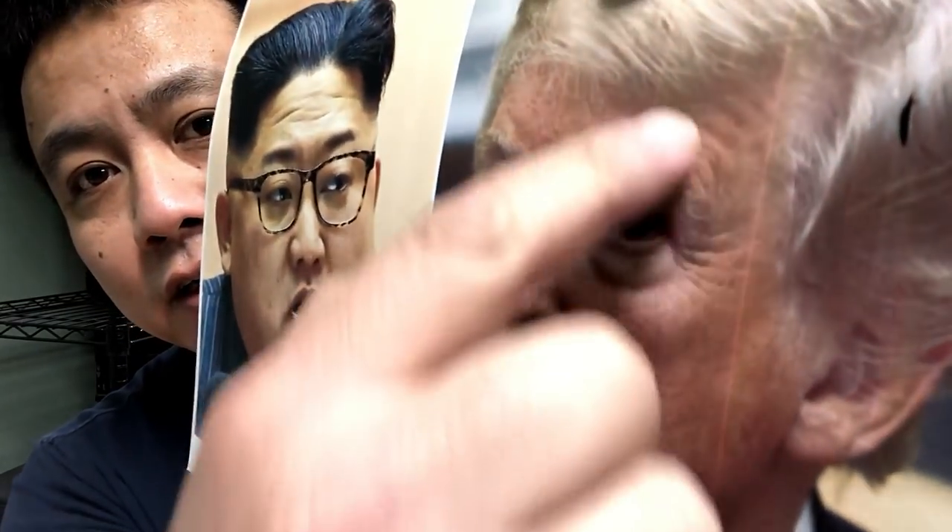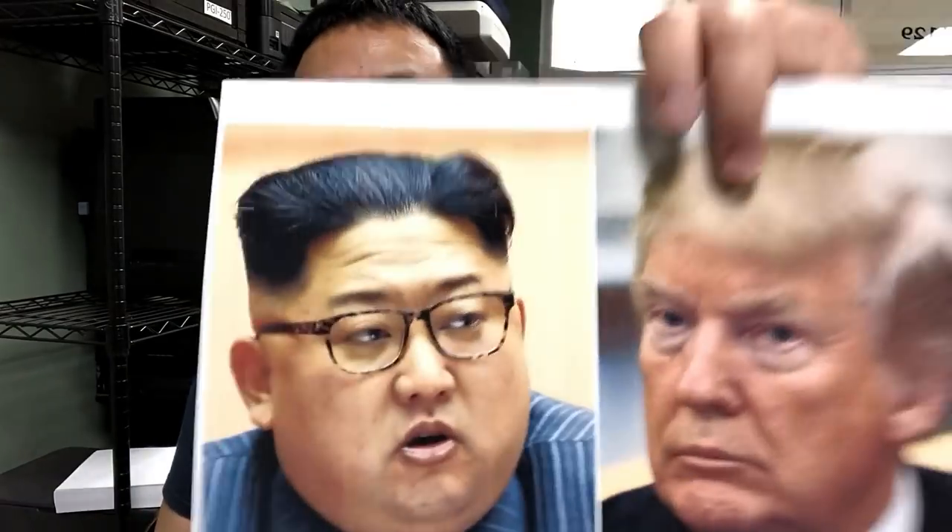The second point is that not all problems are caused by ICC. For example, when we print a photo and you can see lines across the face — that's not caused by ICC. Lots of people buy ink, haven't unclogged their printer yet, and their first reaction is: 'Can you send me an ICC profile?' So we have to ask where you got your ink, are you printing on glossy paper, what brand, and what are your settings?